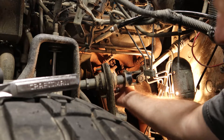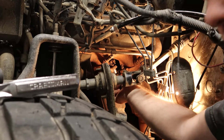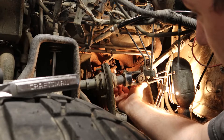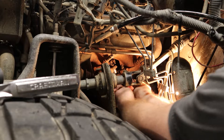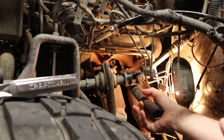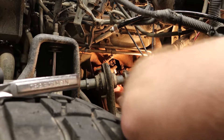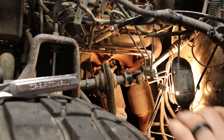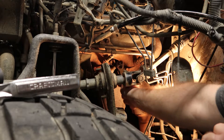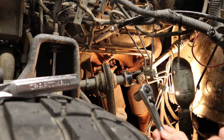So this will get on here. They're very hard to turn. I may hit them up with a little more penetrating oil, but once you get that on there you can abuse your ratchet just a bit with a little length of pipe. Gives you just enough room in here and they turn. All four of them I've gotten about a quarter turn out of so far, just to make sure that they were loose enough to work with. The only one that's giving me trouble is this one right here, so I'm gonna hit him up with some more penetrating oil and work on the other three, and then I'll hit him last. Three-eighth inch drive gets right up in there.